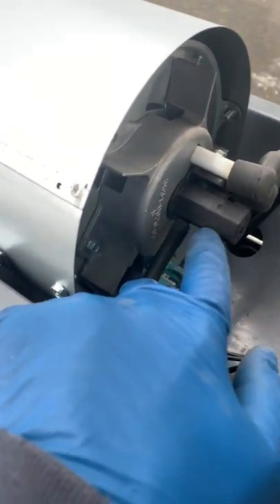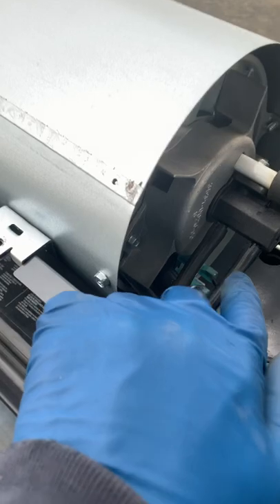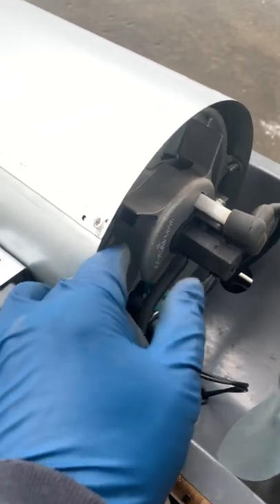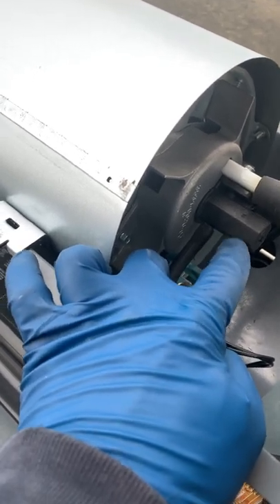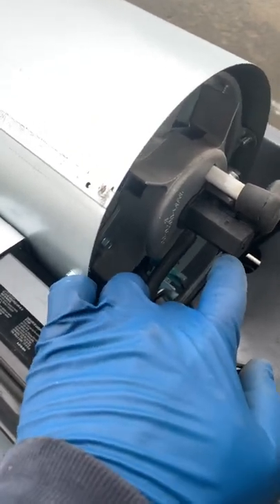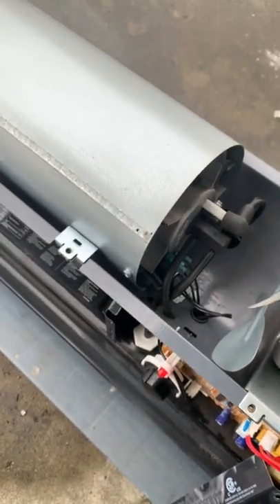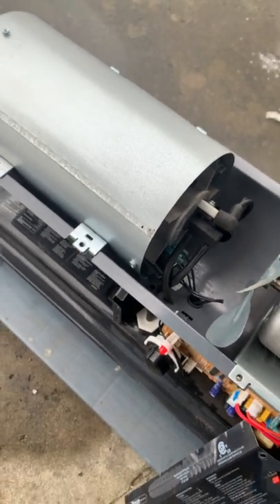They were cracked. This one has a little crack in it but it was cracked all the way down, and this one was cracked partially here. I took the hoses off the nipples — you just manipulate them and they come off — then I used a utility knife and cut down to the bottom of the split. I pushed the good remaining hose back up onto the nipple and did the same with the other one. I turned it on thinking that had to be the problem, but it did the exact same thing — still spitting fuel.